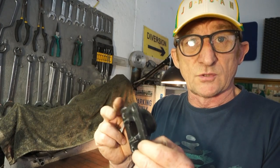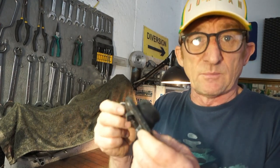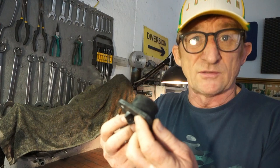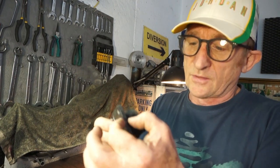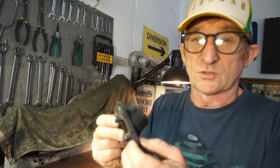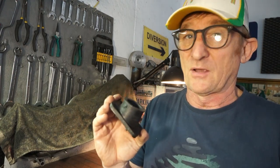And it wasn't too tight, hasn't been overtightened, but as far as I can see, it's simply that this manifold just bends like a banana. It's just not strong enough. The plate that's inside here is going to have to be much thicker if you want to stop that bending. But we don't have that option at the moment because this needs to get back on the road.